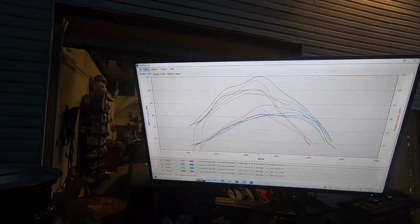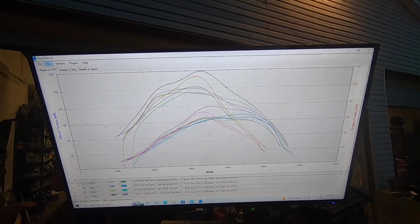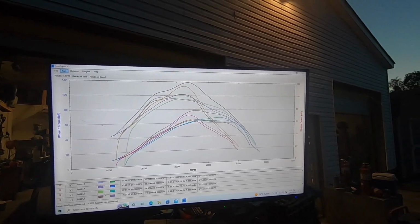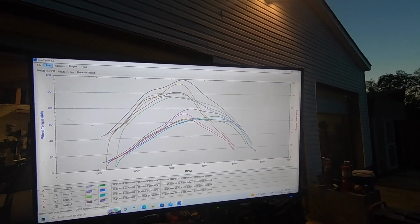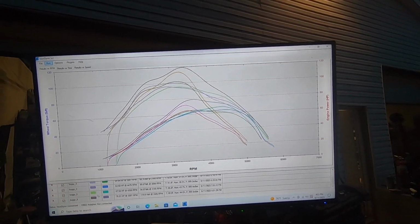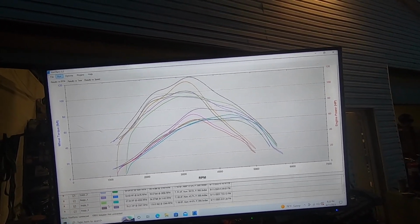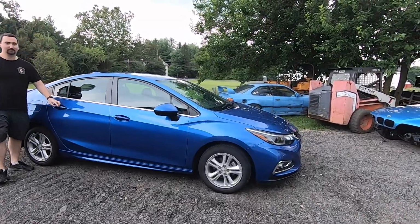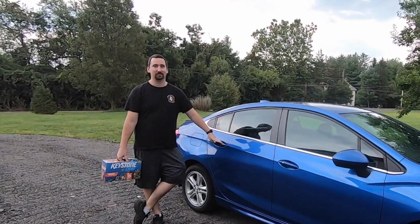So I guess I'm gonna bite the bullet, buy some tools to do some GM flash pre-programming like a dealership would have, and then we'll try to flash that other ECM that way. Hopefully that thing plays nice. There is just too much torque management going on here, and it seems to be coming from a source that I can't identify.